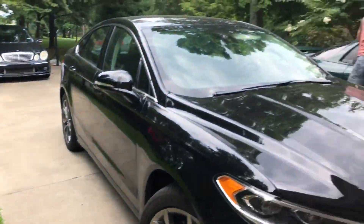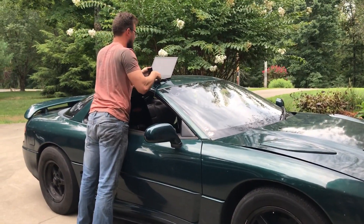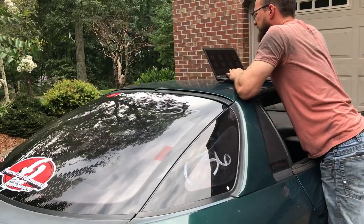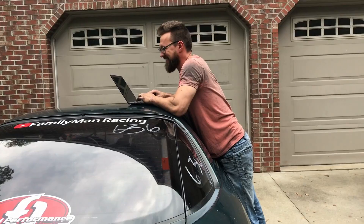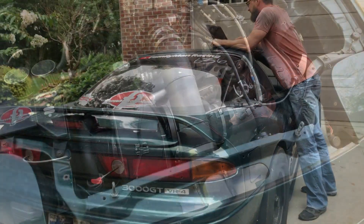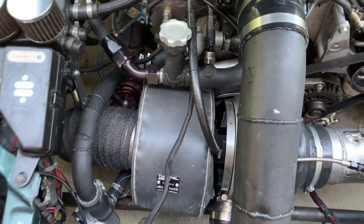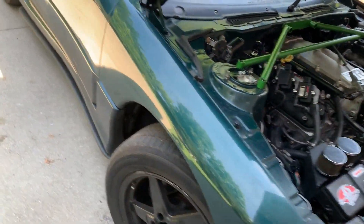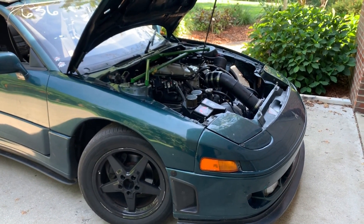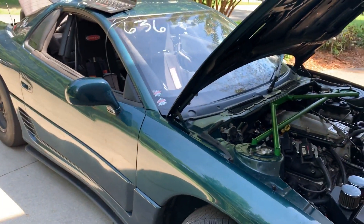Nothing better than a race car on Sunday morning. Well, that didn't go as planned. Obviously the leak there was all fixed, but the coolant temps were really high — just creeping up. I guess the radiator's not getting enough airflow, because when I stopped and let it idle they came back down a little. I did order a better fan — that was just a cheap fan that came with it — so I ordered a Spal fan to put on it. But I may need to figure out how to get some airflow to it.